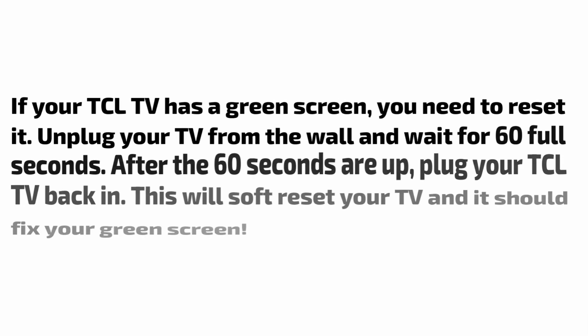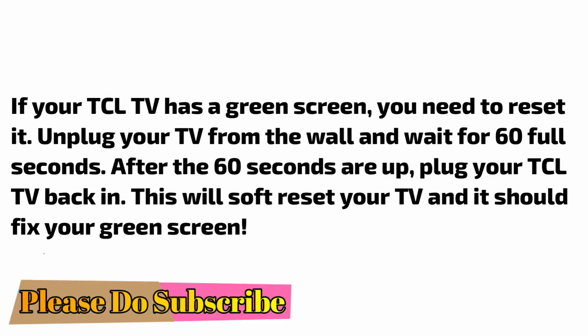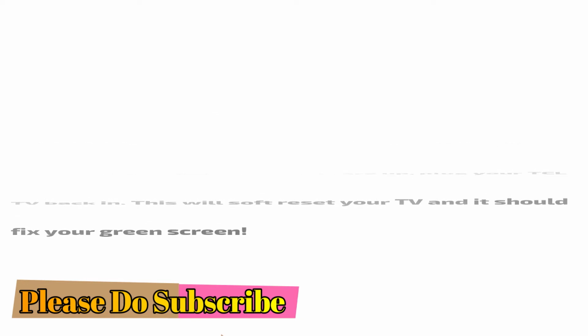If your TCL TV has a green screen, you need to reset it. Unplug your TV from the wall and wait for 60 full seconds. After the 60 seconds are up, plug your TCL TV back in. This will soft reset your TV and it should fix your green screen.